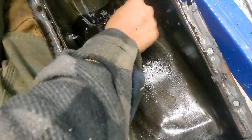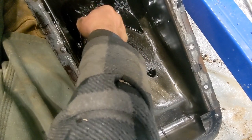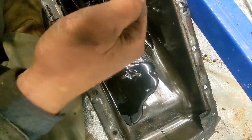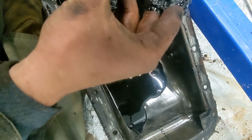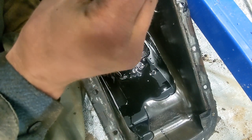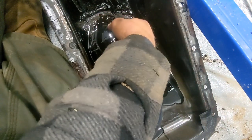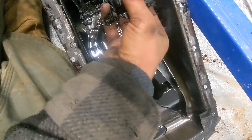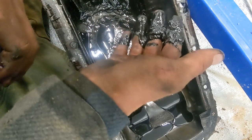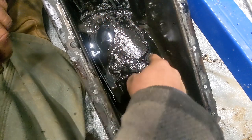This is the inside of the oil pan. Now some of these chunks fell in there while taking it off. Look at all that - gross. I'm not even sure what that is. It's metal. That's nasty. I don't know how easy that is to see on camera with that gray, kind of silverish tint to it down here in the bottom - that is just chalk full of bearing material. That sucks.